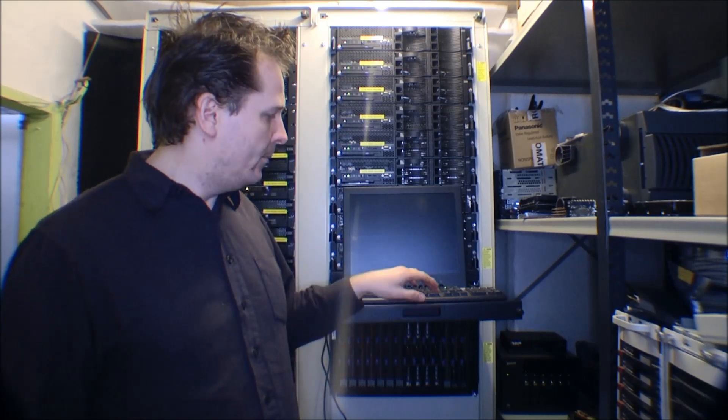I just made a video where I put new disks in this bottom server, and found that you can put 2TB SATA disks in here. He doesn't need that much space, so I will exchange those for 73GB SAS drives — 3.5-inch, 15,000 RPM, 73.4GB drives. I am going to put six of those in his server and configure them as a RAID 5.